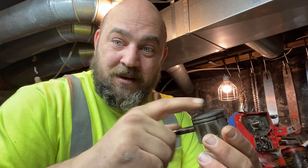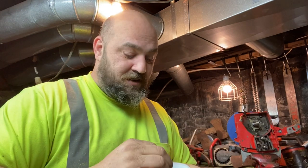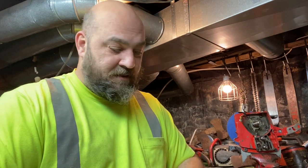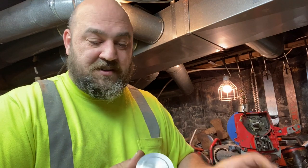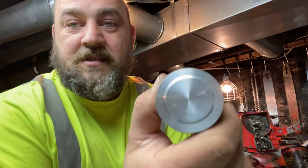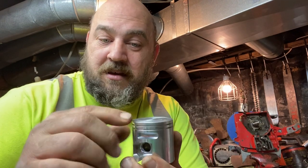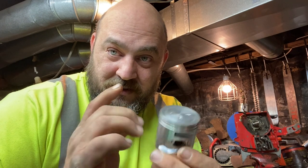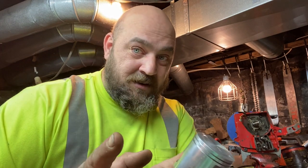One of the reasons I wanted to discuss this is there are more factors to consider than just squish. So if you have a piston with a pop-up — here's one sitting right here — see the center of that, we've got a pop-up. The squish would not be affected, but we are going to affect the compression because we have a pop-up. There's more to consider than just squish.